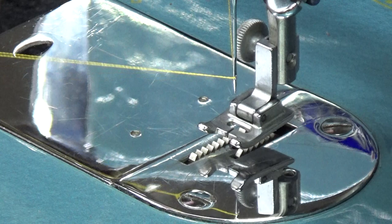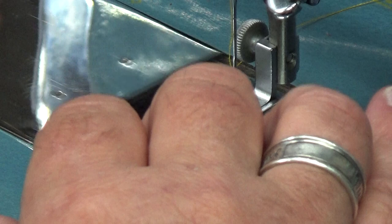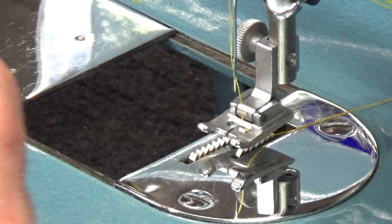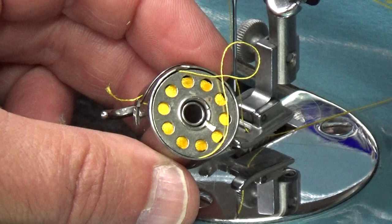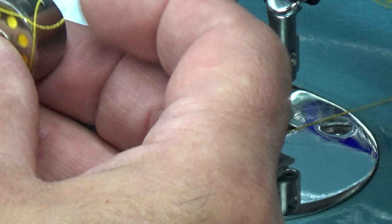Well, that happens sometimes. I was pulling on that a little bit anxious, and I just popped my thread, which works out nicely because I can show you how to pull that thread back up now from the raceway. And again, we are working with an embroidery thread, so even though it's around 50 weight, it's not going to be as resolute. Oh, look at what else happened. See that? That thread kind of came away from the roll of the bobbin, and it caught on the outside, which explains also why partly our thread was not feeding well. So we've got to resolve that as well.